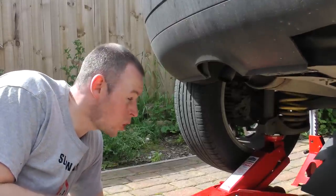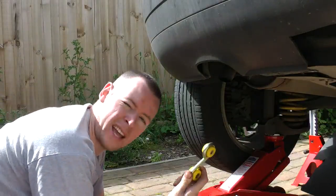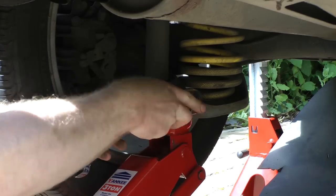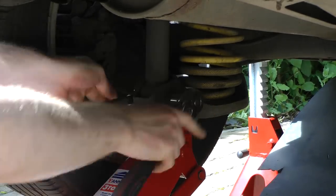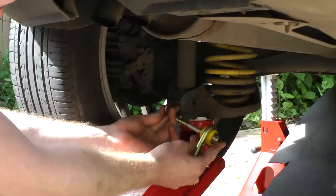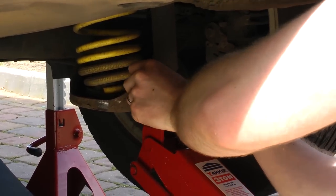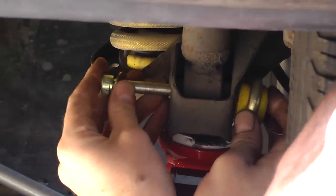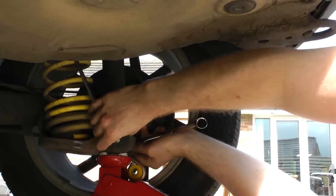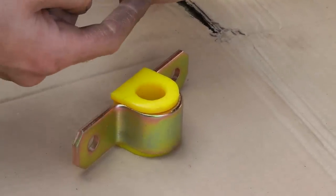We're going to jack up the bottom of the original shock absorber, and then we're going to replace the bolt — take the bolt out and replace it with this new bolt and washer set, and have this drop link go on the new bolt. The instructions say to put the short bolt on the chassis mount, but as you can see, that will not work. What you have to do is use the longer bolt that's supplied, and bolt that through the bottom of your shock absorber mount, with a large washer on the wheel side.